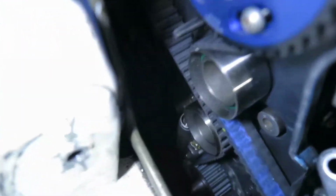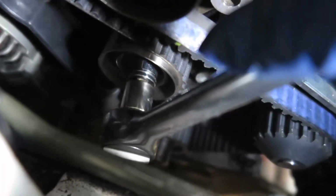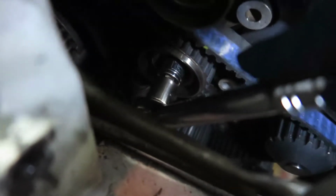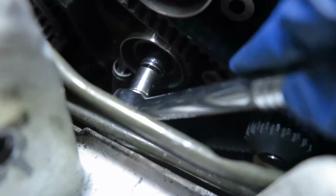Yeah, so this is what I think so far. See a little shininess there on the tensioner right here. It seems to be oil. It should not be like that. Second thing is, look at the belt moving back and forth. Let me try to look at this. This is definitely, I mean, with a big vibration, it would definitely not be good.